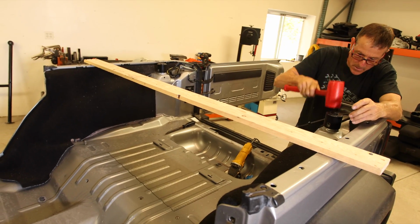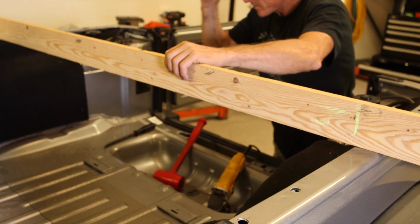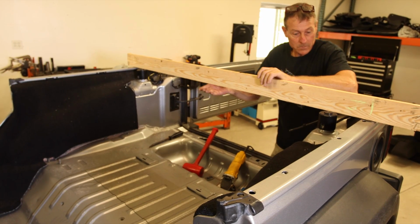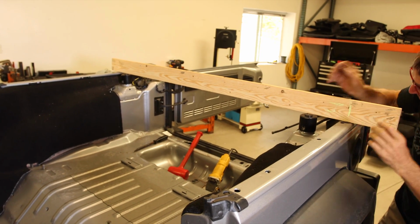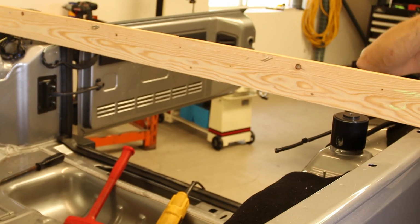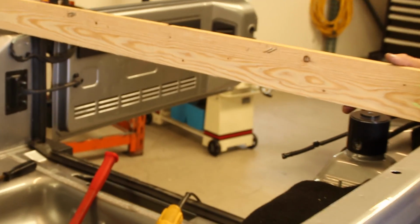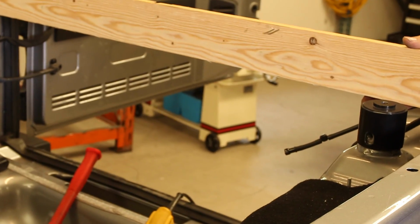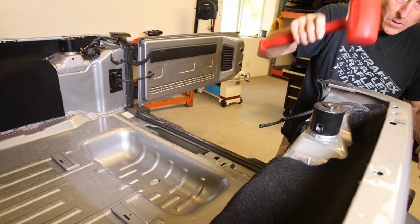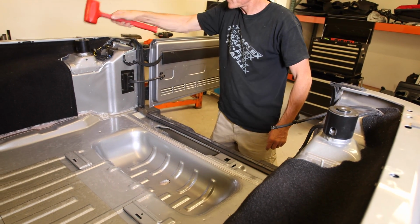With the sport bar caps in place and the slotted holes lined up with the existing through hole in the bar mount, you should be able to double check your accuracy by once again using your calibrated slat from the shipping crate and placing it across the rear of the Jeep from one side to the other. The edge of our straight edge should just meet and rest on the step-down flat surface, not the raised centerpiece of our sport bar cap. Just remember, when positioning the straight edge on the tub, there will be weather strip on the bedside.